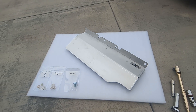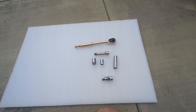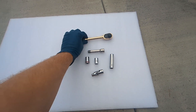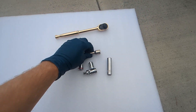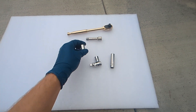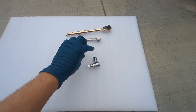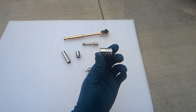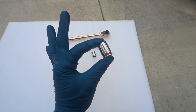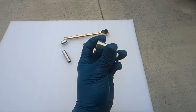Let's go ahead and show you how to install this thing — it's not that difficult. For tools, this is pretty standard on any toolbox, but you'll need a 3/8 ratchet, a two or three inch extension, a 14 millimeter socket, a 12 millimeter socket (I recommend a deep one for the 12), and a 13 millimeter socket. For the 14 millimeter socket, make sure it's a shallow or medium in length — don't use a deep well. And then a 3/8 U-joint.